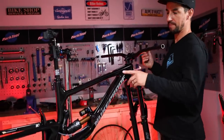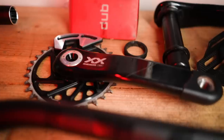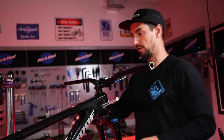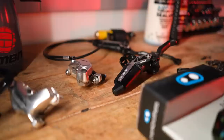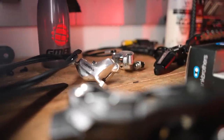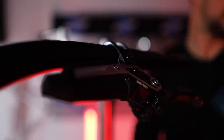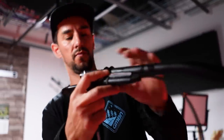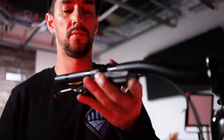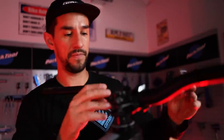So far, so good. I'm using the SRAM AXS, the new transmission stuff, so that makes my life so much easier — I'm not running cables and hoses, just set for the rear brake hose which I'll route through the internal routing. I'm using some bits I already have, so I've got to change the length of the hoses when it comes to my brake levers. I'm bolting everything on loosely at the moment, trying to get the angles there or thereabouts for bar roll and things like that, to get hoses as close as I can to the right length. I'll always find that I'll take the bike out on the trail first time and be tweaking levers and bar roll. I know where I want them — it's kind of in line with the fork, so I need to roll this a little bit further forward.